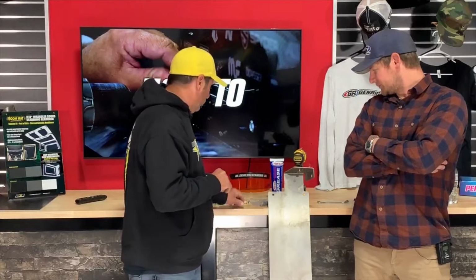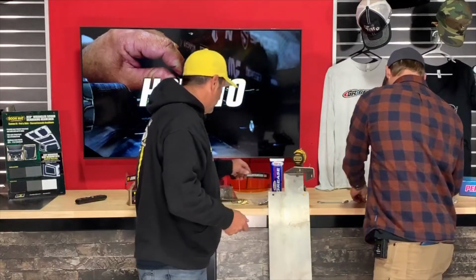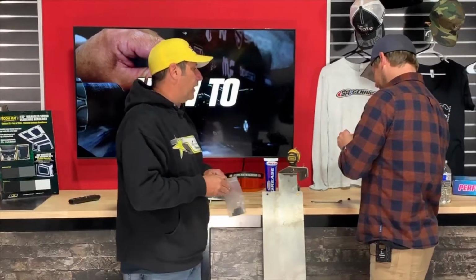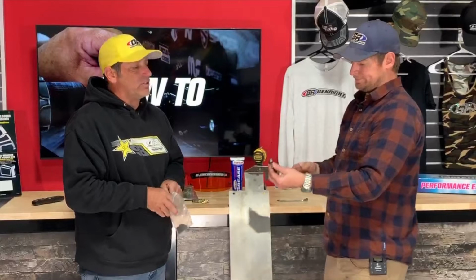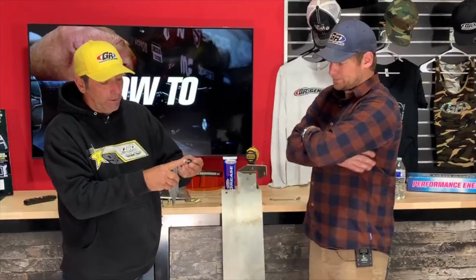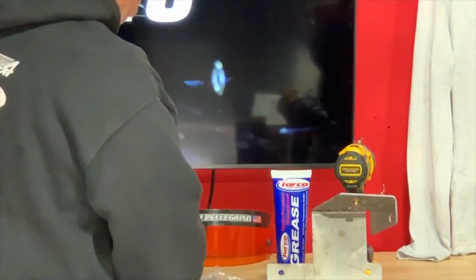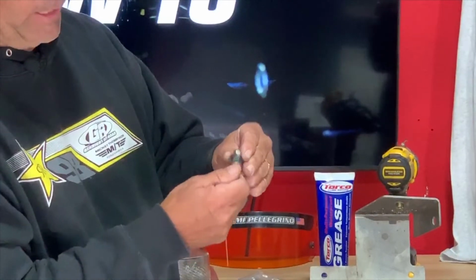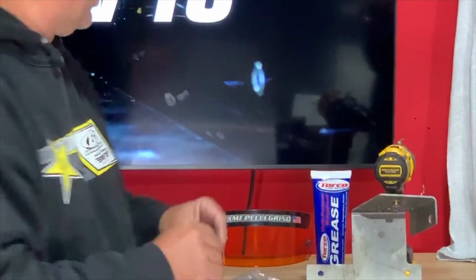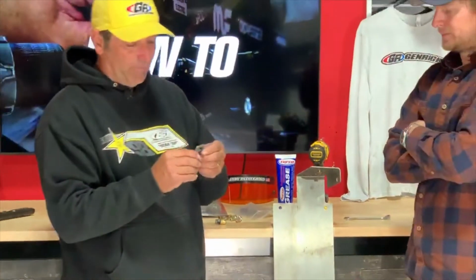So we always give you, where's the little 1/4 inch one? Show them what that is. It's just a couple of special washers. We give you some hardened washers, and then the nut that's oversized, and this is called a flange nut, and it's got a knurl on it. So this is what grabs the top of the Rivnut when we're screwing this in. And it's really important to put grease on these threads before you thread on the Rivnut to install it in your Jeep.